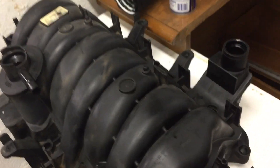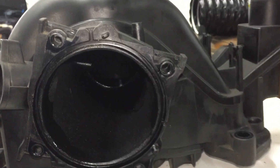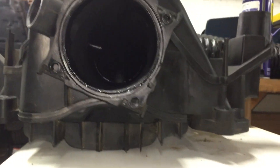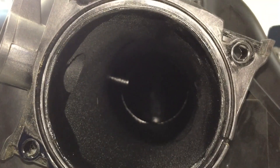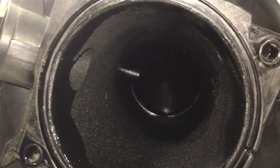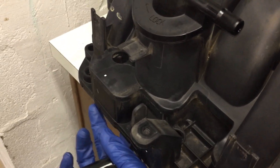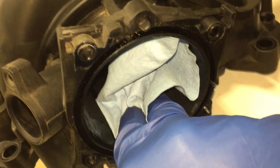The reason I'm cleaning the inside as well as the outside is that on a modern car you have EGR - exhaust gas recirculation - and also the PCV system. That little tube on the left is where the PCV valve connects back to the intake. You have vacuum from the intake that draws oil vapors out of the crankcase, and some of it collects in there. If I come in here and wipe it - look at that - that's nasty stuff.